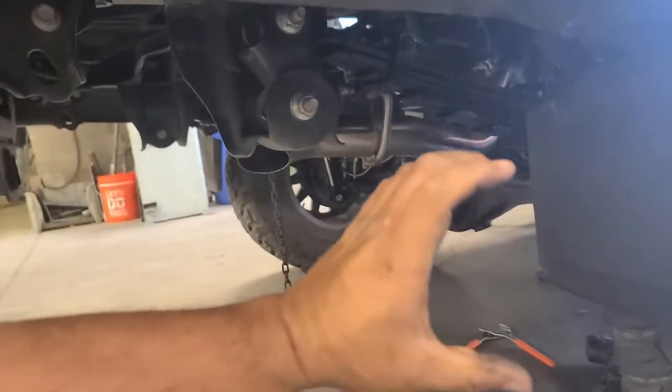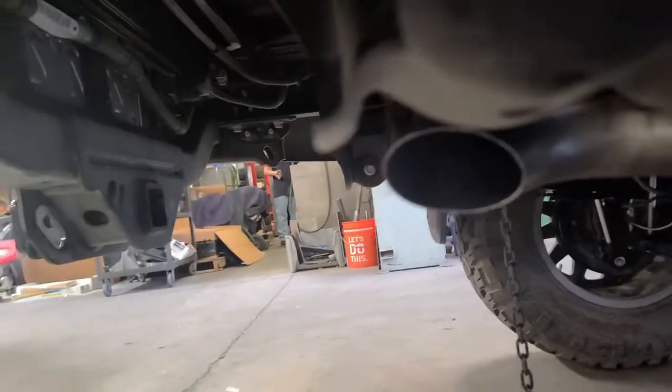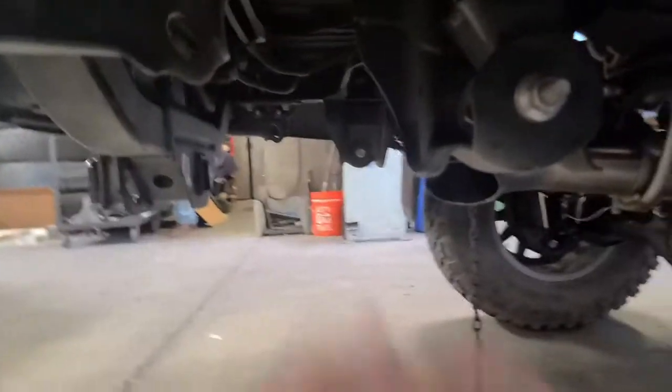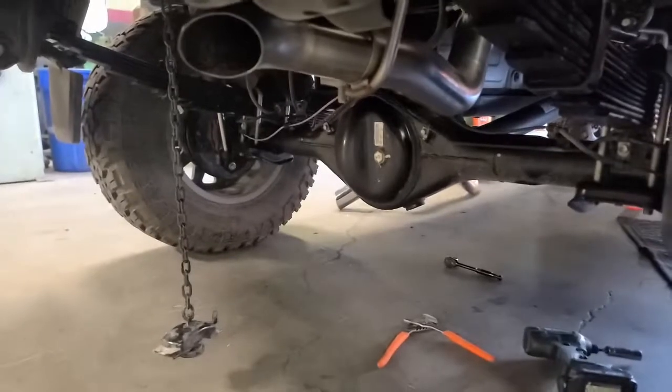As you remember before, we had a tailpipe that was down here a good 4 inches away, and now we are tucked right up on the bottom side of that hanger, and if you can see, even with the lowest point. So now if we're going to come up and hit anything, we're not talking about smashing the exhaust into the plastics or the body panel of the vehicle. So we're going to do some torquing and get everything back up to spec.